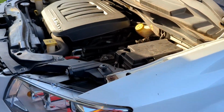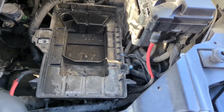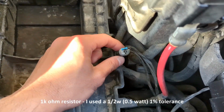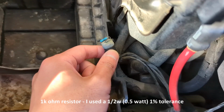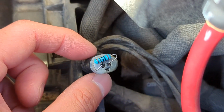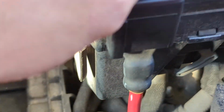This is for a 2011 Dodge Grand Caravan. If you're trying to install the hood ajar switch or bypass with a 1K ohm connector, this is the spot right here. This is where the ajar switch would go, so this is where you would find the connector to stick that 1K ohm in. And this is what it is, I'll link it in the description. It's right underneath the TIPM fuse box.